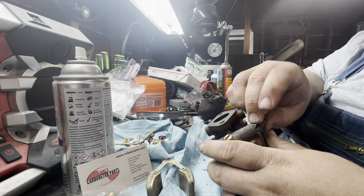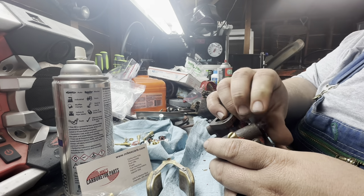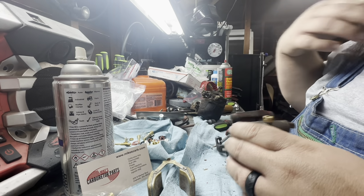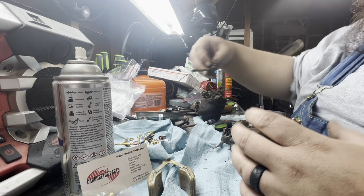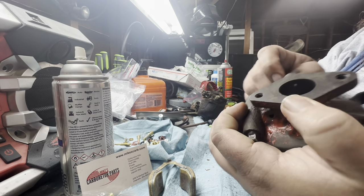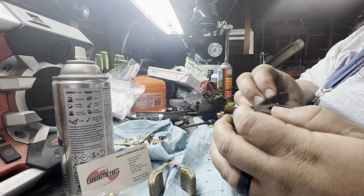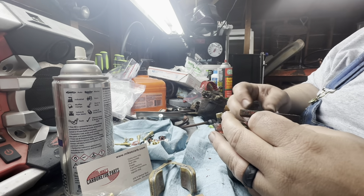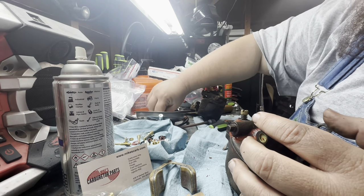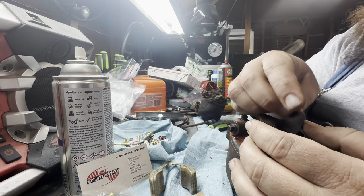Okay, this goes here. I don't have to worry about that. Yeah, let's just turn that up. And one thing this kit has is all of the gaskets and different things for around the throttle shaft. These ones are pretty good, if they're not leaking or you've got air leaks around them. I don't always do those, to be fair.